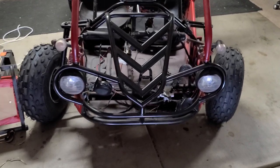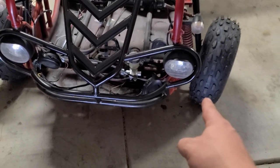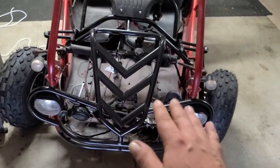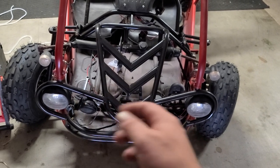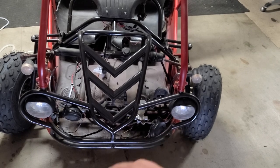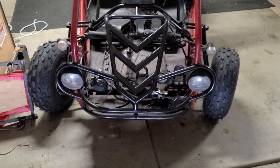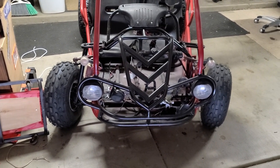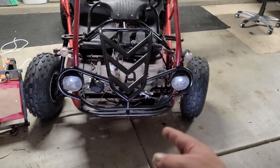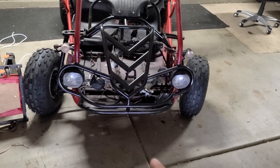So here's where we're at. Started bleeding the master cylinder and having some issues. I got fluid coming out of this line, a little bit coming out of this line once in a while, and from the rear I'm getting nothing. So I'm going to do a gravity bleed — just open the bleeders, pull the top off, and let it sit overnight to see if we get a little puddle underneath and confirm the brake fluid has made its way in. Redbeard's Garage has a great video on how to bleed brakes — please go check him out. I'm learning how to do this myself, so I don't want to take any of his thunder. He's a great dude and you need to check his channel out.